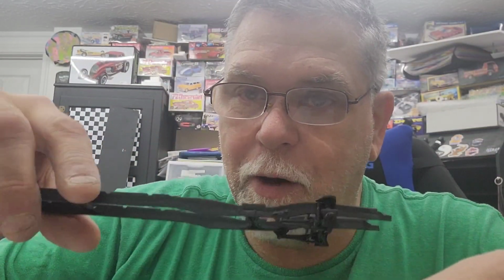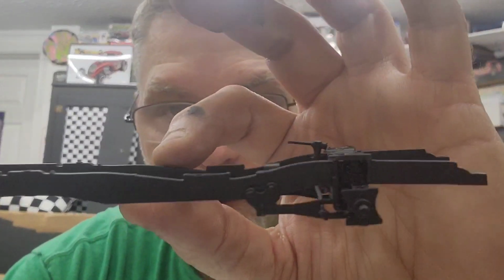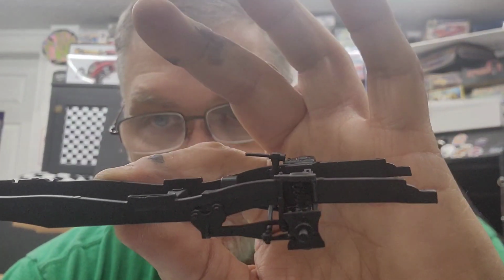And it works very well. I mean, I know guys do the hot water thing, and they've got all kinds of other methods, and I've manipulated it before, and I found over time that plastic will find a way to come back. Then I picked them all up to look at it, and I got real emotional. I'm like, well, I never had this before. That's because the frame was warped, and instead of heating it in water or whatever and holding it until it cooled down, this way you've got it sitting on the tires. It can't go any further than this. The only thing it can do, if you get it too hot, is this plastic will go lower where the weight is, and you don't want that.